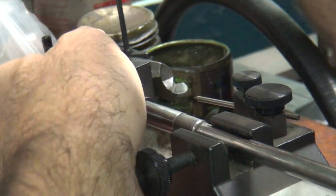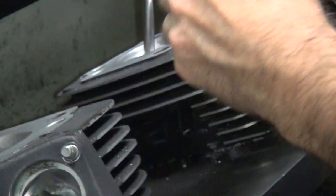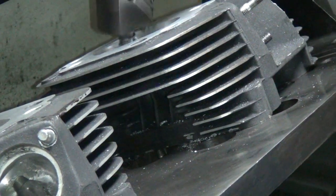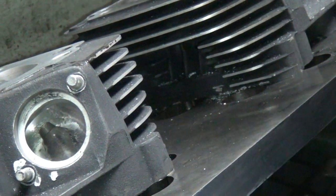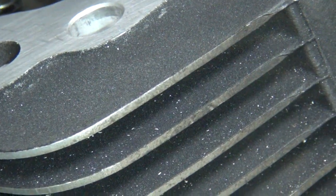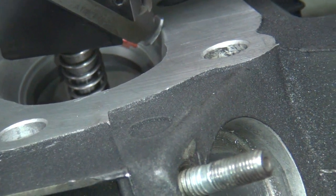The workbench isn't full of heads anymore. Yeah, I know it's not — except for yours. Okay, now just like we did on the exhaust we're going to do on the intake. If you do a quick look down there you can see — the cutter looks like it's in the right spot. See, it doesn't cut much on this side — it cuts right there. But look what it does on this side. That's not even close to being equal flow out of your valve. How do you make a nice even flow around your valve head when you've got one side that's completely masked by a wall? That doesn't work. So you lose compression and straighten out the air flow — you pick up more power everywhere, you don't have any stupid detonation.